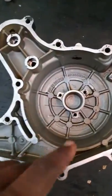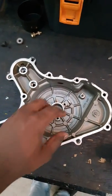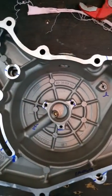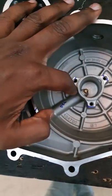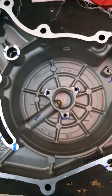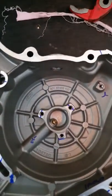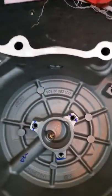So if you see this, this is the old case — it's plain and simple, just a metal case with the stator to be placed there. And this is the new magnet cover case. If you notice, there is an oil injector there. What this will do is supply oil to the stator coil and keep it a little cool so it lasts a bit longer. That's the difference between the BS3 and the BS4.